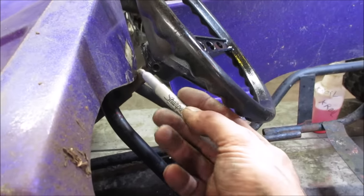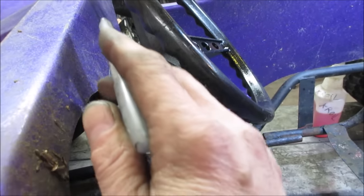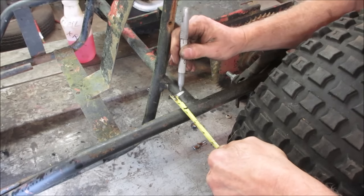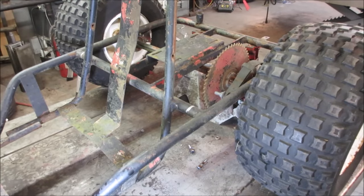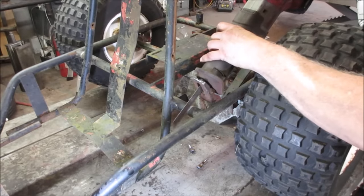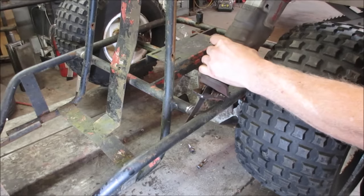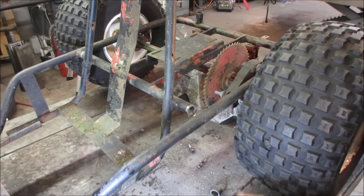And as far as the steering, what was that? Big steering column. Well, let's go chop something like that off right there, going across, and allow his dash to kind of drop down a little bit. Look how close do you think I got to being an inch on that? That's an inch right there. We do the same on the other side. No turning back now. It's pretty thick. I'm gonna do the same to the other side.